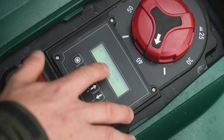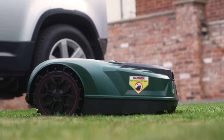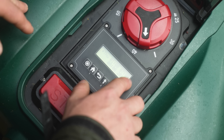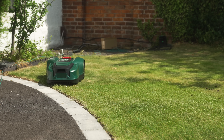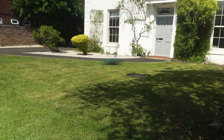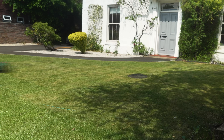The unit has numerous modes — you have spot mode and schedule. In spot mode you place the robot physically in a spot in your garden, put it in spot mode, and it will simply do circles until your lawn is cut. It can do schedules per day; I have this robot set to come on every single day, four separate times throughout the night. It finds the border, turns in a different direction, and then mows in a straight line again. The downside of the perimeter wire is that without precise mapping, you can't get straight lines in your lawn. But over the years of using robot mowers, I thought I'd hate not having lines, and I'm starting to love the fact that with a robot mower you can have your lawn looking like an actual carpet.